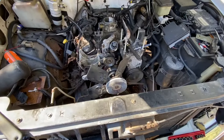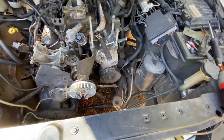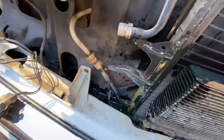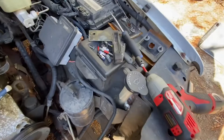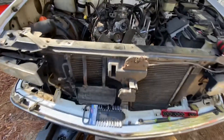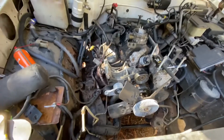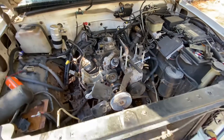I wasn't really sure how far I was going to get. Not quite finished up yet either, but I got a few things taken off the engine: air box, AC compressor, got the AC lines all disconnected. Got a pile of parts here — took the parking lights out, grill off, to get to all those lines and stuff. Got the heater hoses unhooked. Just kind of chipping away at it.